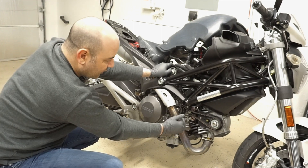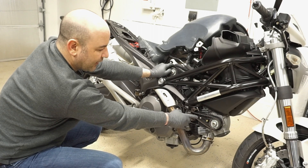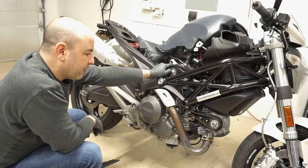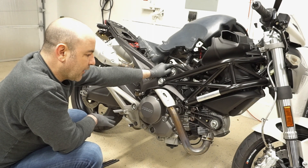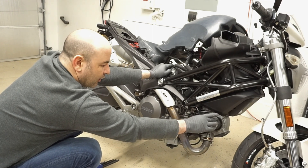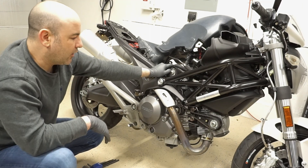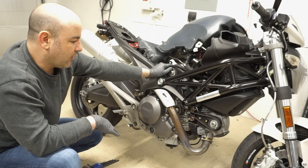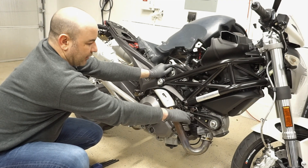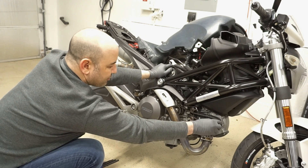First step is to get the engine at top dead center. I don't know if that's mandatory, but that's typically what I've done on my Yamaha dirt bike for checking the timing. Then the next step is to mark - you can mark the teeth on the cam sprocket as well as the belt, to make it easier whenever you replace or add the new belt. You'll be able to easily count the number of teeth on the belt, and also make sure that the cam sprocket hasn't moved.